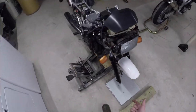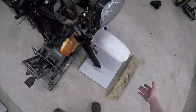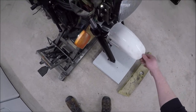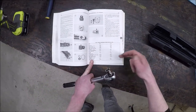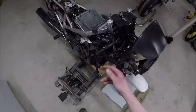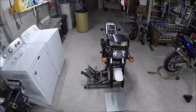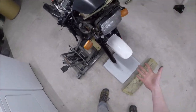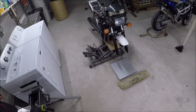Reassembly is pretty straightforward. I'm putting the forks up through - this is always a pain because I can't get the fender off unless the wheel is dropped, so I'm putting it in now so I can loop the speedometer cable through it. I need 33 to 40 foot-pounds on the braces, 7 to 9 foot-pounds on the uppers, and 11 to 22 foot-pounds on the caps, which I'll tighten with a 24mm once the other bolts are done. I'll put the wheel back on, hook up the speedometer cable - and I'll lubricate that before I do - and fork seals are done.